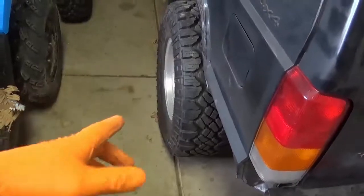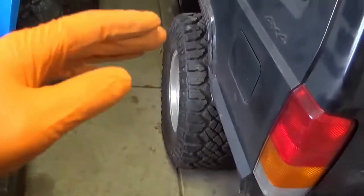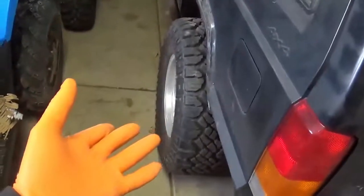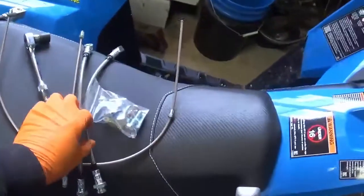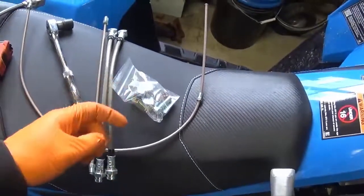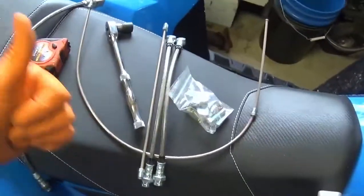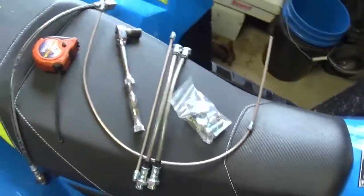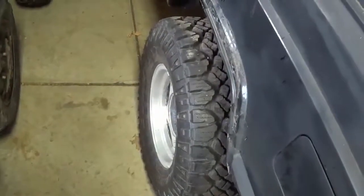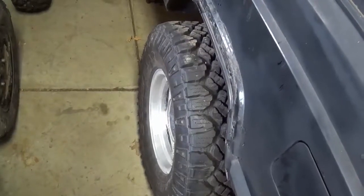So if you want to do this, you can copy my measurements — just be aware that to do it correctly, you need to tack everything on, bolt it up in the vehicle, do some measurements, make sure it's centered, and then take it back out and reweld it. I tried to cheat, but it kind of bit me in the ass, so don't do what I do. Just tack it, check it, and then do whatever you need to do — if it's okay, good; if not, take it off and redo it again. But anyway, that was my 8.8 update — I'll see you next time.